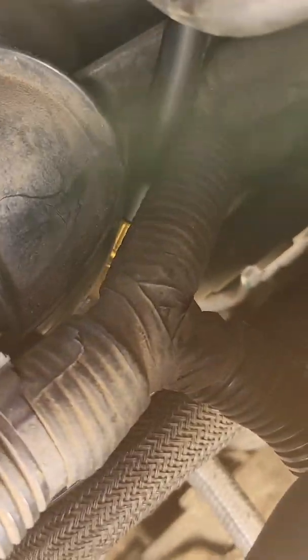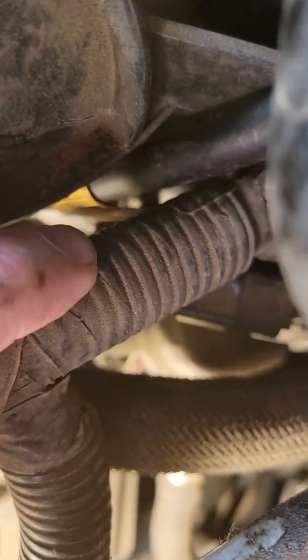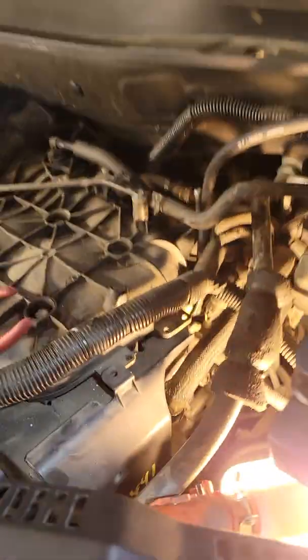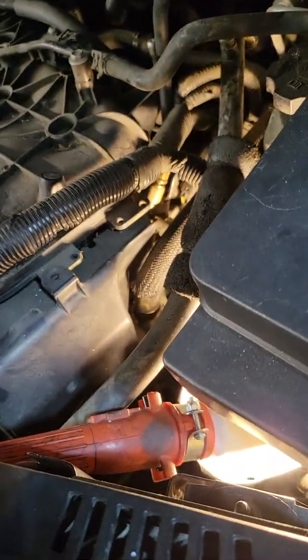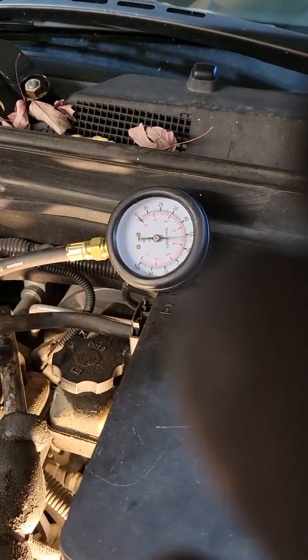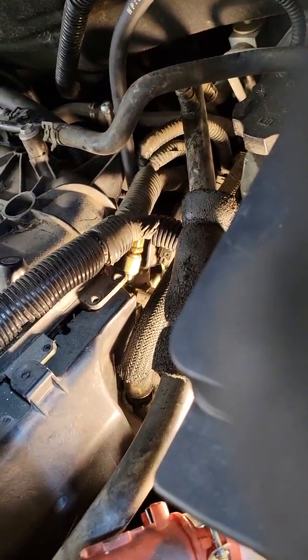It was the larger of the two fittings they sent me. I got it on there — I went in behind that hose and straight down and it locked right on. I just need to tighten it up. It feels like it might come squirting out the other end since I've got nothing on that end yet. I'm going to check it with the gauge and see if there are any leaks before I call it good. We got about 65 PSI — good seal, nothing's leaking. Great.